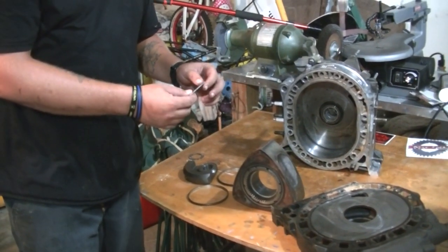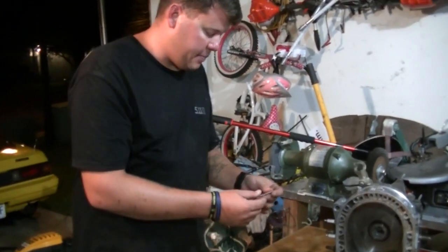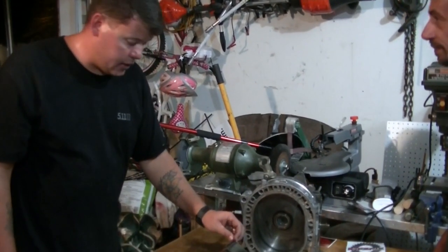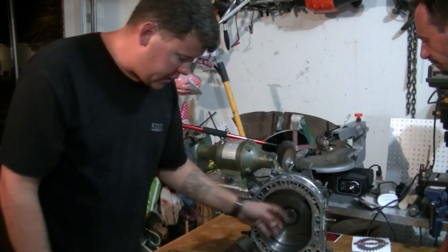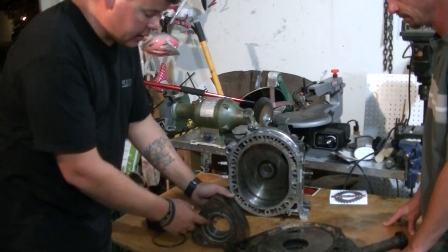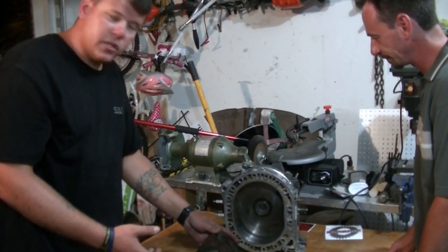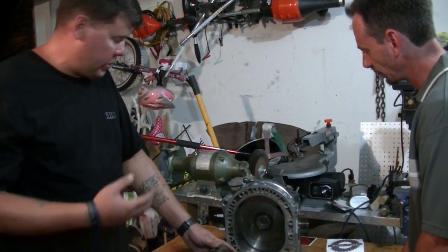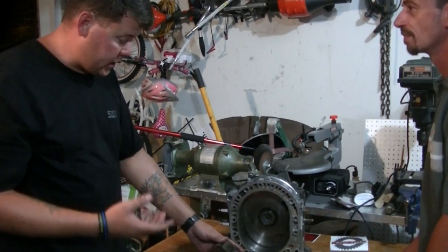The 3 millimeter apex seals were stronger than that of the predecessor going down to a 2 millimeter apex seal. You can apply boost, and as long as you apply fuel, with the simple changing out of the planetary gear and the gear inside the rotor that it rides on to keep you from spinning a rotor, you can spin these things up to almost 11,500 RPMs simply. It's about air, fuel, and spark. How fast and how adequately you can do it.